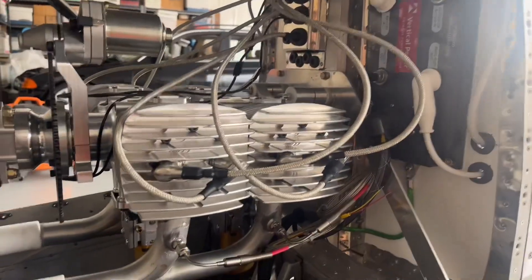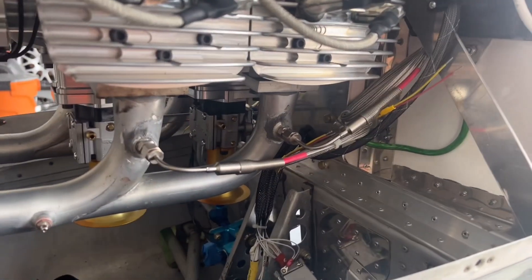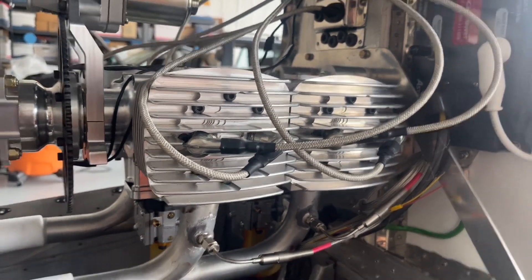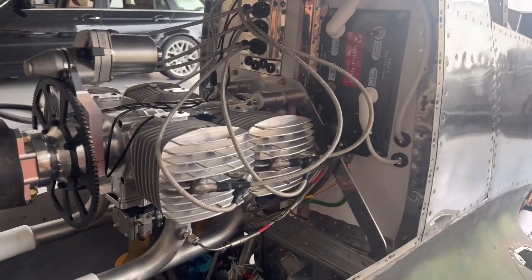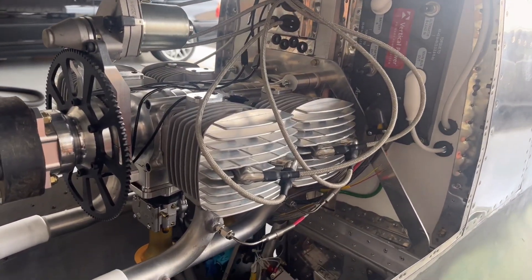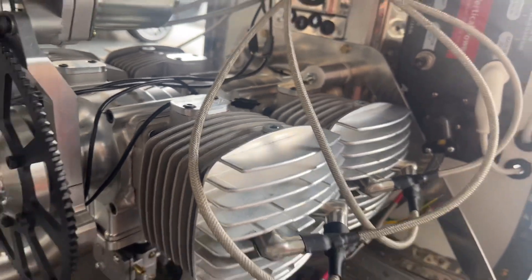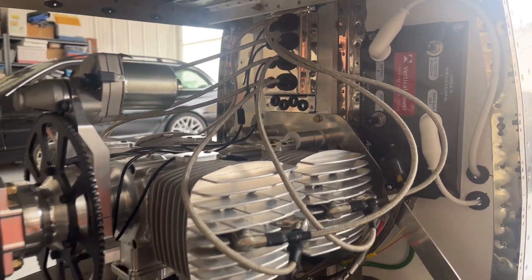On the rest of the wiring for this engine - that's what the plug arrangement is going to look like. There are the EGT sensors, and then the CHT sensor is going to come off one of the spark plugs. I might look into those little threaded inserts you can see there - those are for compression relief if you're hand-propping in a powered parachute or large-scale RC aircraft. They're just plugged on mine, but I think I could put the CHT sensor right there.